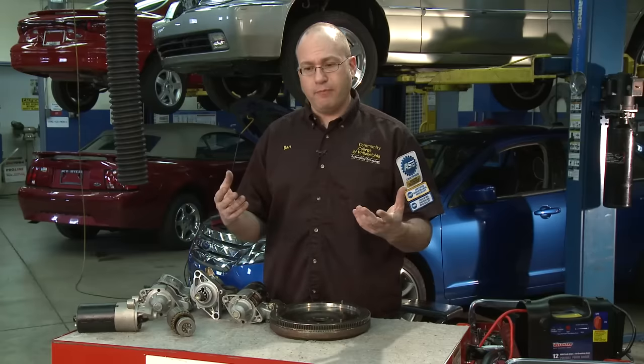You may wonder why there's such a big difference in the size of the gears. It takes a lot of energy to crank an engine, and we get that energy by moving through a small gear to a large gear — giving us a gear reduction. Generally, for every one revolution that the starter turns, we get about 1/20th of a rotation of the flywheel, so the ratio is about 20 to 1. That gives us a lot more torque — we sacrifice speed for torque. The starter motor spins fast but the engine doesn't spin as fast, yet we generate enough torque to actually rotate the engine. It's hard work — you can't easily attach a ratchet to an engine and hand crank it. You'd need to be quite strong or have a large lever.